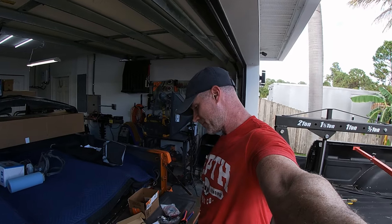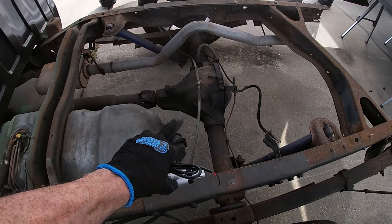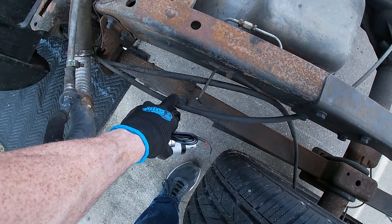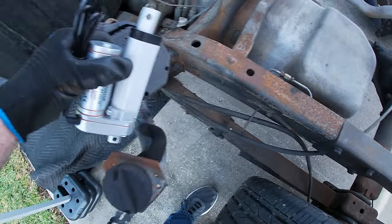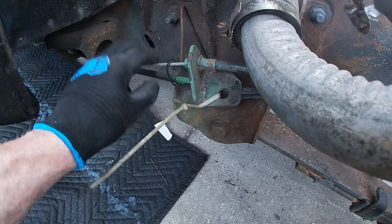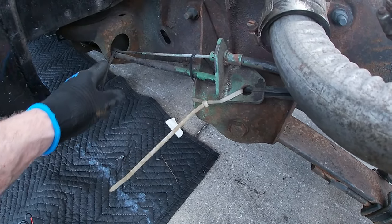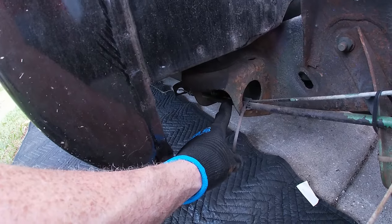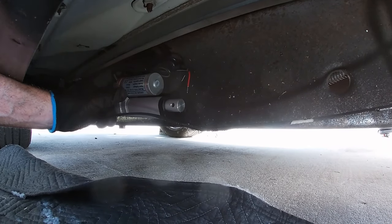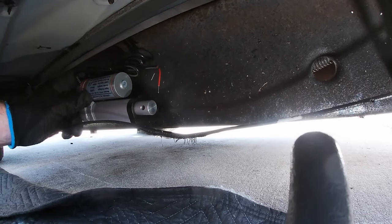Let's go. Let's start off with each one of the rear wheels has a manual brake right here. This one here is for the passenger side. This one here is for the driver's side. They join up over here. Obviously, these zip ties aren't supposed to be here. Fix that after the fact. And they become one over here. There's like a joint that merges them together. My plan is to mount the linear actuator somewhere along there and hook up that parking brake cable to the end there.